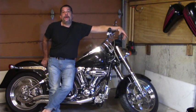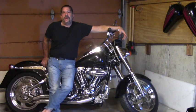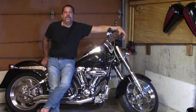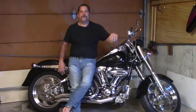And that's about it. Charging systems, not a lot to them. Don't be afraid of them. Hunker down, learn a little bit before you dive right in. You'll be so grateful, so proud of yourself when you find the loose connection or the pinched wire, or you pull your stator out and find it just crumbles in your hand. You'll be smelling like burnt copper wire, but you'll be proud of yourself. You're able to diagnose and repair it yourself.